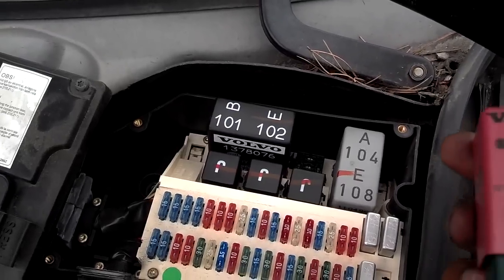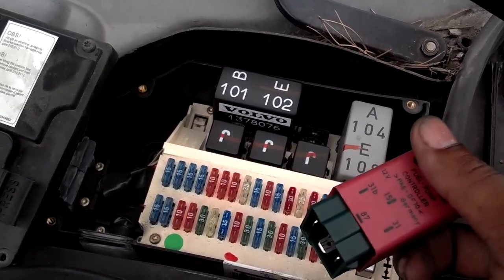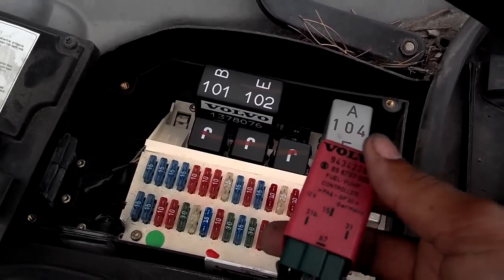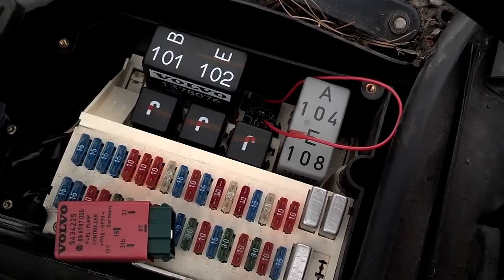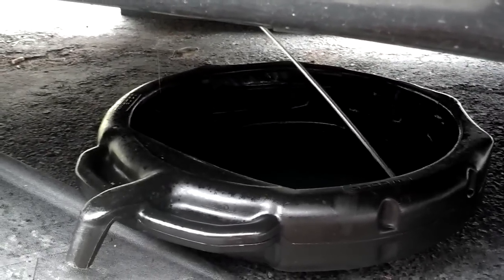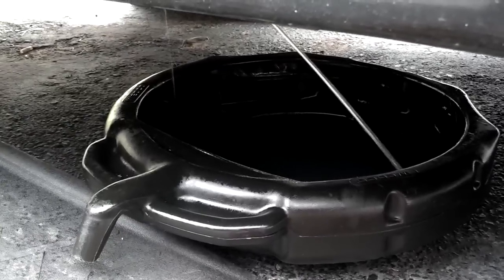They say if you jump pins 15 and 87, the fuel pump will come on. Sometimes just pulling the relay and putting it back in will allow it to work for a little while. You could replace it, try that, or jump it to make sure the fuel pump comes on. I've got the wire in there like that — all I have to do is turn the ignition key on and the pump should turn on and run until I turn the key off. I turned the key and the pump is running. I disconnected the fuel line so it'll run continuously — that's how you jump the fuel relay.